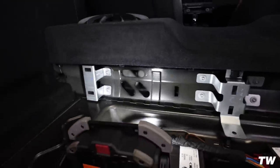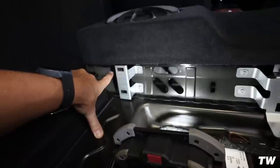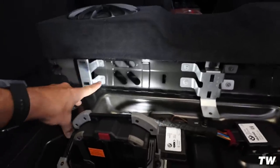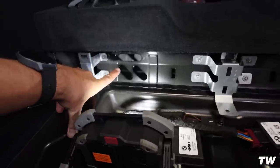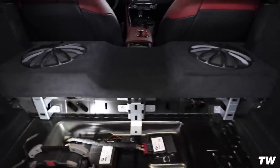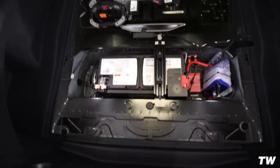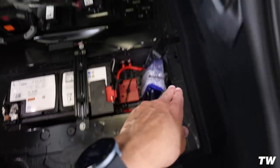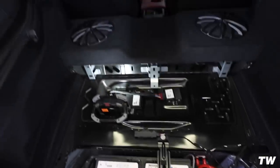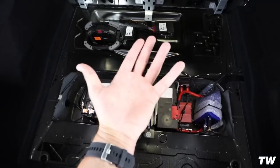And so the foam that we're gonna be using, some of the foam is gonna go in between the metal box and then these little hardware pieces. And then also the wadding, we're gonna be putting a bunch of wadding back into the hole over there to kind of fill up that empty cavity in there, which should greatly enhance the way that this sounds. Once we get the Dynamat, we will line up the Dynamat back here on all of the exposed trunk parts. That should make a big difference too. That will probably also help with the exhaust noise coming through from underneath.